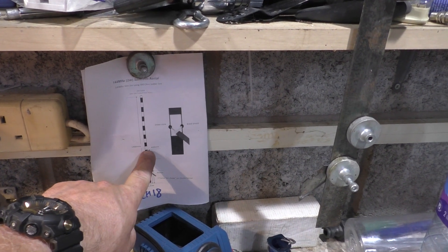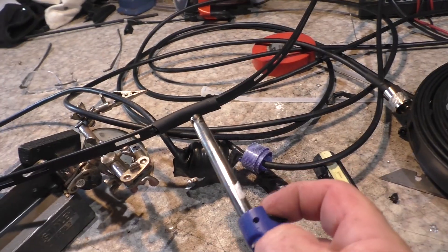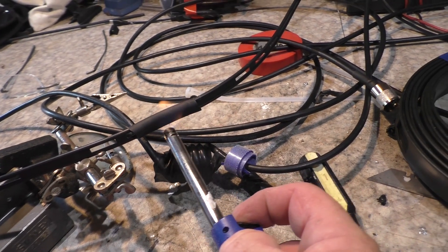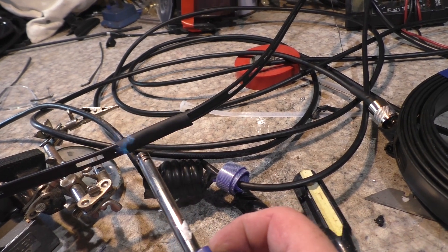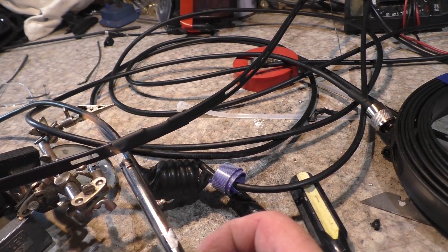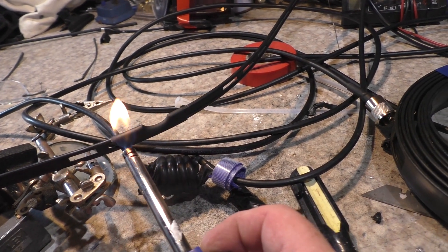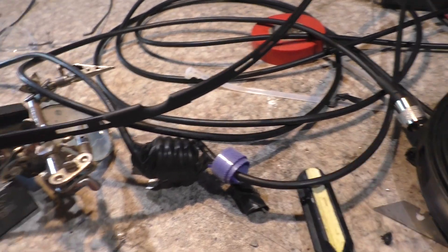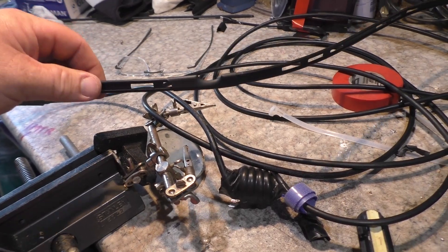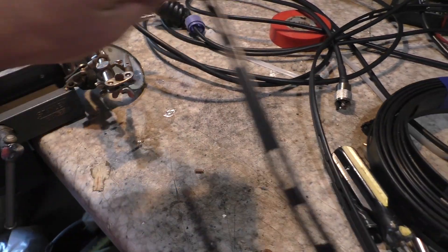Sorry for being unprofessional holding the camera at the same time! You can see that gap there — if you look at it on the diagram it'll all make sense. All I'm going to do now is heat up that heat shrink and make that connection good. As the heat shrink gets hot the glue inside melts and forms a nice seal. I know I'll probably get comments about using a flame rather than a heat gun, but as you can see it still does the job.